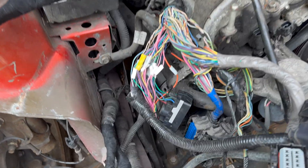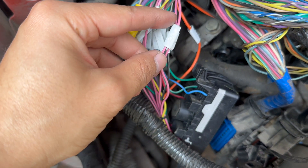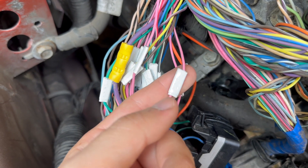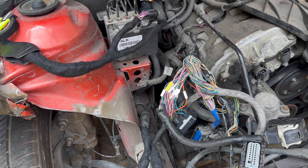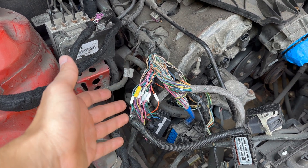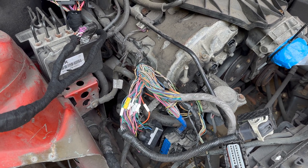What I've been doing is inspecting all these connections. I don't like how the old ones look — they're swollen and not clean. So I've been cutting them, twisting the wires together, putting solder on them, then heat-shrinking them, wrapping them in electrical tape, and then wrapping them in this cloth tape just to make it look cleaner — it's fire-resistant and tear-resistant. That's the process. Now I'm just going to finish this off-camera so I don't bore you guys with 30 minutes of wire cutting.